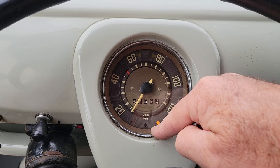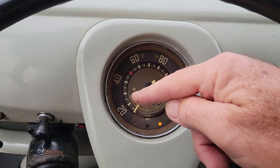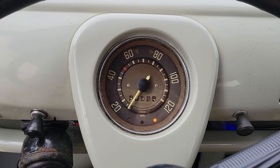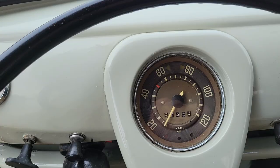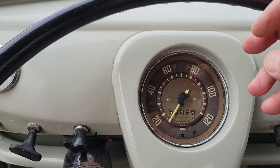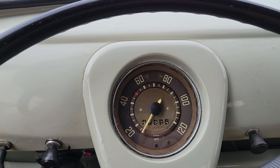Two reasons: number one, if your belt comes off when you're on the road and you have no generator belt, you need to know — and the only way you may know is if that generator light comes on. So if you're driving down a highway and your generator light comes on, pull over right away and make sure that your belt didn't come off or break. Because if you have no belt, you have no fan, which means your engine is going to overheat very quickly. Most of the time it'll give you a few minutes to get over to the side of the road, but it doesn't take long before you hear that death rattle — a pinging noise. You better shut that motor off; it's hot as hell, and it only does that for a few seconds before you blow a piston.